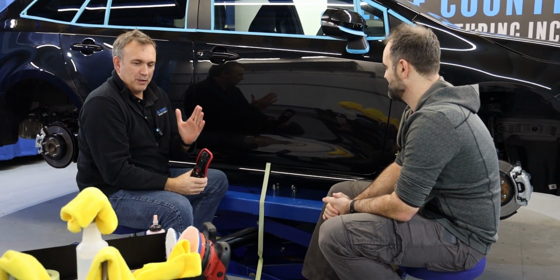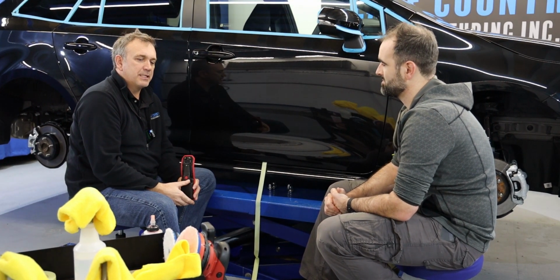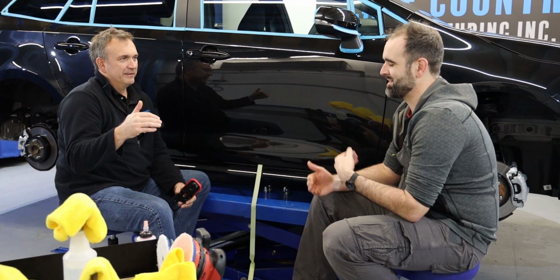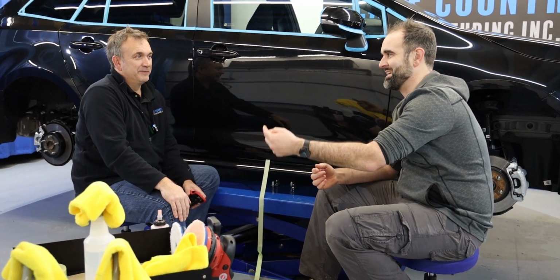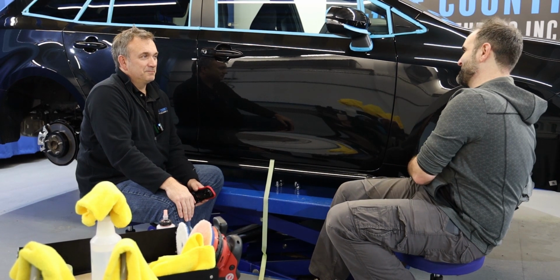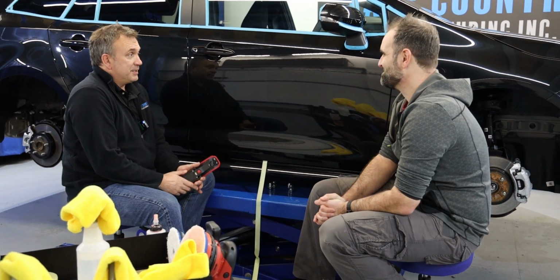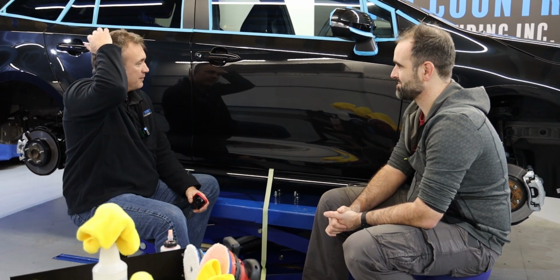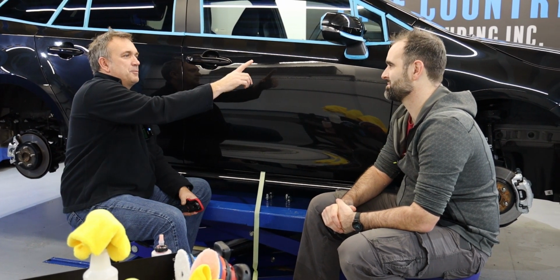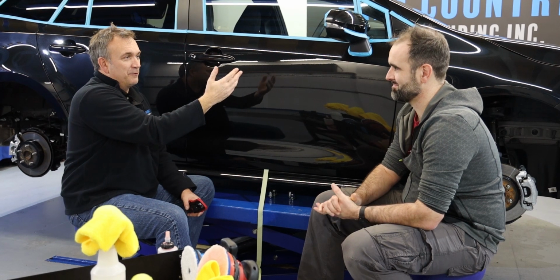Definitely. So my approach was actually to stick with something slightly more aggressive, and I suppose this comes back to old forums and the detailing world. Everyone taught you to start with the least aggressive pad and compound. Spend an hour or two first finding the right pad, the right polish, work your way up to get the correction, and then work your way back down to refine it. Yeah, you spent a lot of time experimenting to start with. And I've had loads of people say to me they've gone up to a car and spent hours test patching all around the car. The problem you have, especially if it's an older car, is that the test patch panel may be original or could actually be aftermarket paint, and you found a sweet spot on that panel.